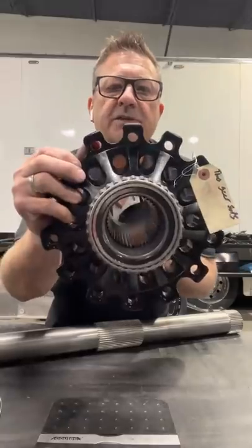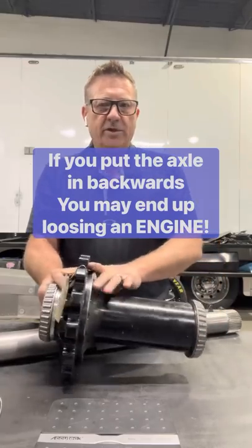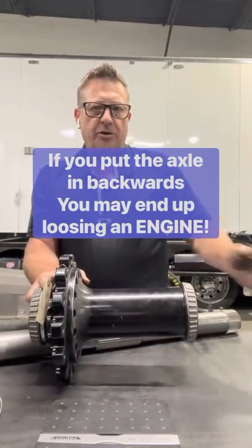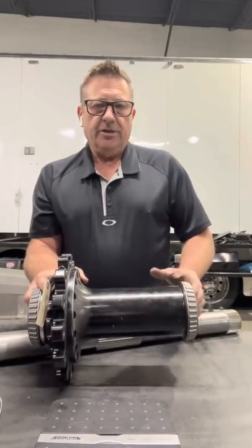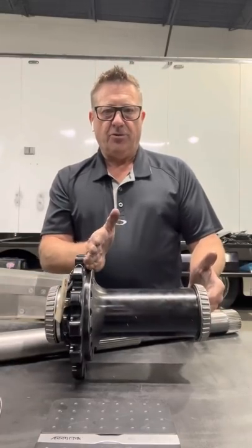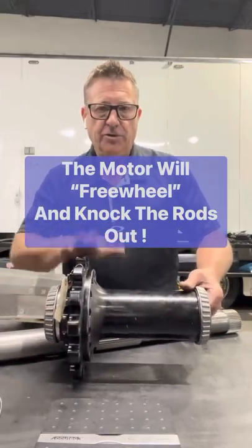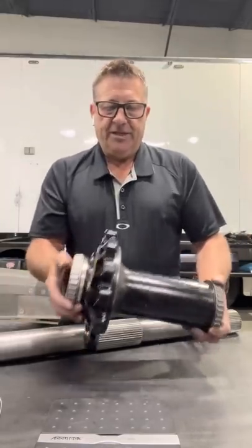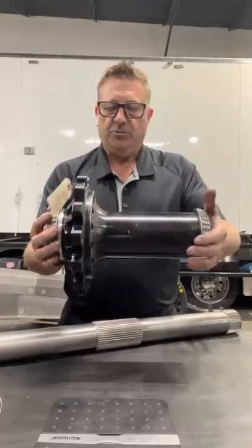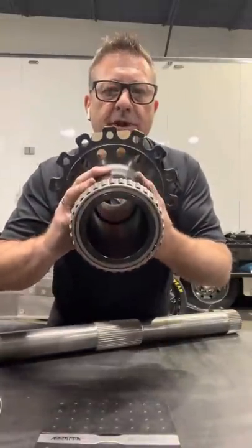The spool inside of it — you'll see a spline right there. One side of the axle is longer between the gear cuts, the splines, than the other side. The reason why is because the ring gear is clear over here since the pinion is sitting here. You want it to be as close to the ring gear as possible — you don't want to drive the axle on this side of the spool. You can see the splines are really close on that side compared to where they are on the other side.